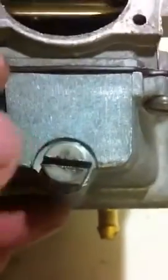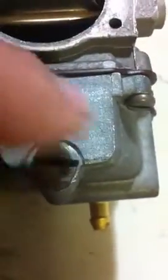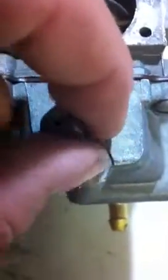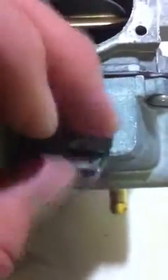This right here is what you call your high speed jet. You pull this out and on the inside they have a jet — really small openings — that's where your high speed jet is located. You can adjust those, but they're very hard to do whenever you have three carburetors on it, so I suggest not messing with them.